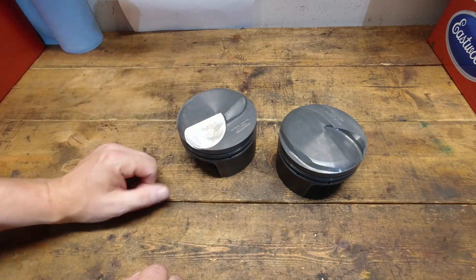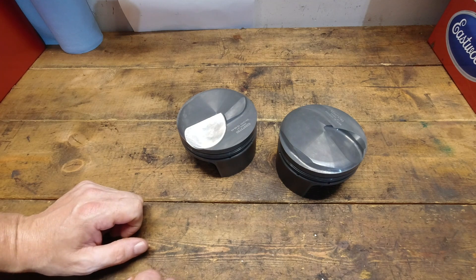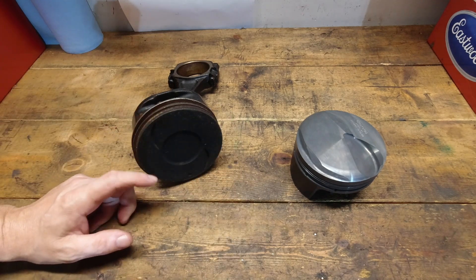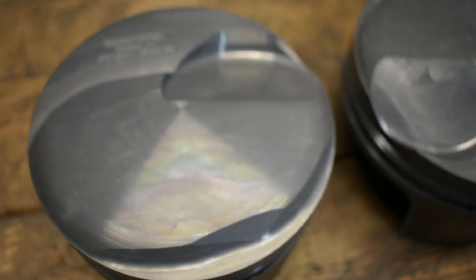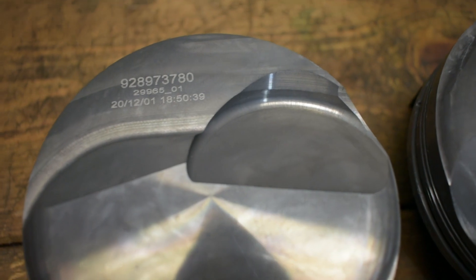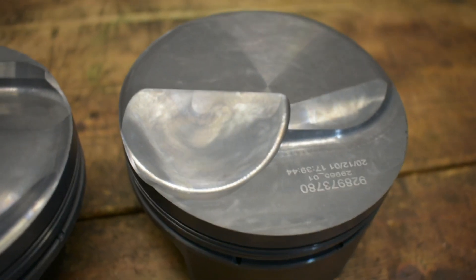I'm certainly not opposed to putting a turbo or a centrifugal-style supercharger on in the future, though it would need a cylinder head change because the compression is a little too high. Whatever your brand choice is, if you're not sure about the material or type of piston, call the manufacturer — they all have really good tech lines and are always very willing to help you sort out what you need. Mahle is my preferred brand, but there are so many good piston manufacturers out there. Don't be afraid to be a Diamond guy, or as a racer only use JE — those are fine, nothing wrong with that. They'll tell you what you need, and maybe a forged piston isn't even what you need — maybe a good hypereutectic is right, depending on what you're using it for and how much abuse it's going to take.